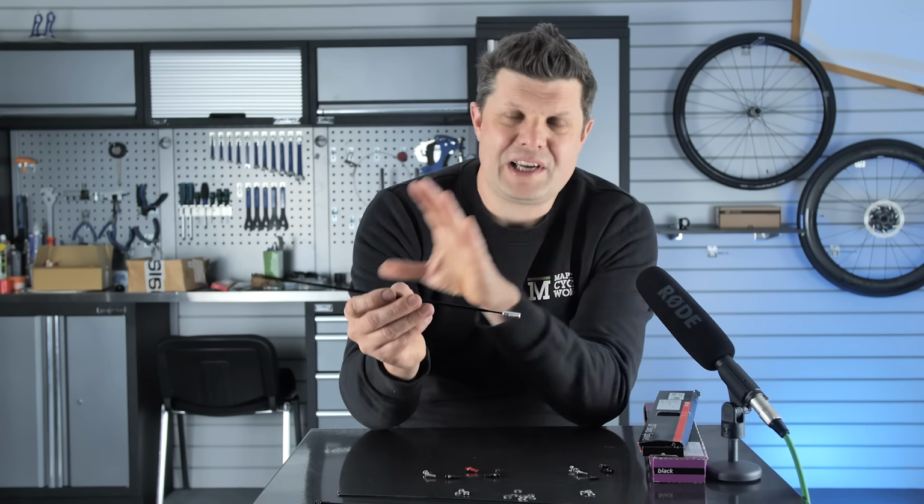So now you've got a range of rim widths that are going to suit the tyre choice. You now need to consider your body weight and the desired tyre pressures. So if you are looking for a hooked rim, it's dead easy. If you're fairly light and you need a very narrow tyre, just look for a rim that's got a 19 millimeter or very close to it profile, and you'll be absolutely golden. If you're slightly heavier and you want a slightly wider tyre, a 21, there's actually loads of range there to play with as well, not a problem at all.